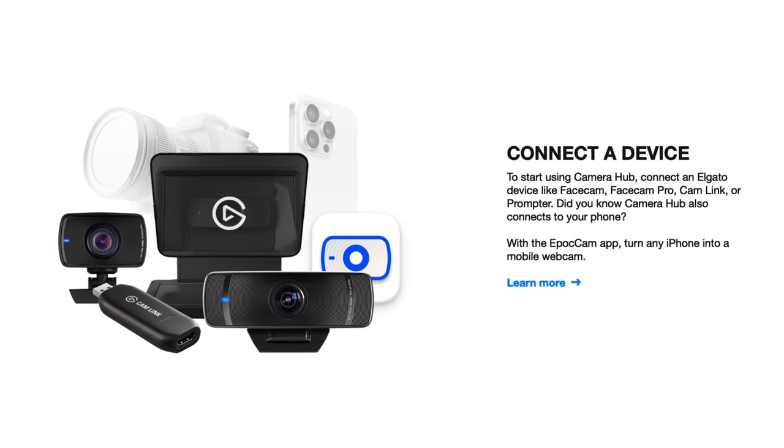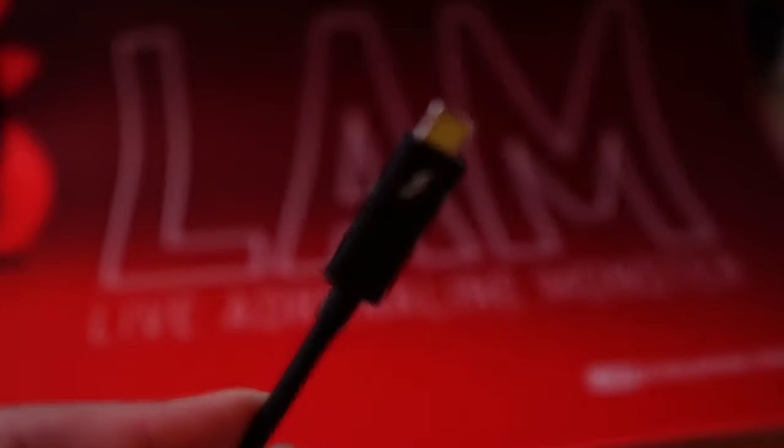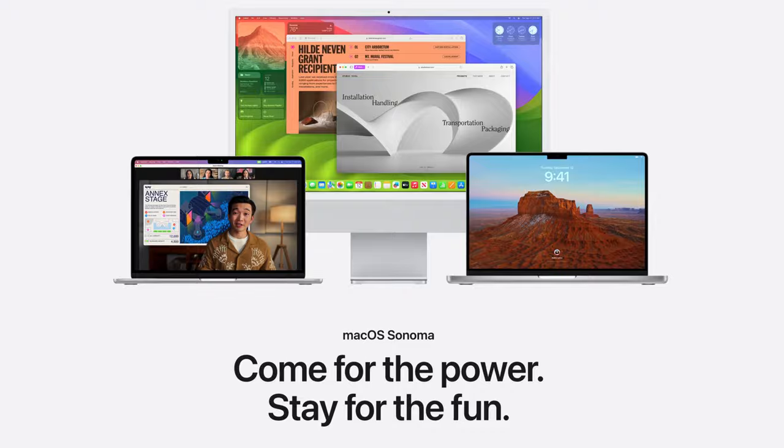Camera Hub will show 'connect a device' even though it is connected. Restart the computer leaving the cable plugged in, then open the Camera Hub software again. If that doesn't work and it still shows the connected device screen, try a Thunderbolt cable — that's the cable with the little lightning bolt instead of the included USB cable. This has always been the solution for my many tests on multiple computers. Once I do that, the regular USB cable that came in the box works fine. Sonoma has proven to give me the most trouble, just heads up.